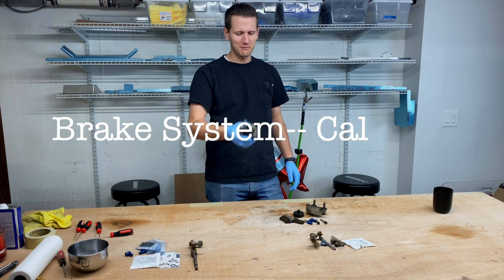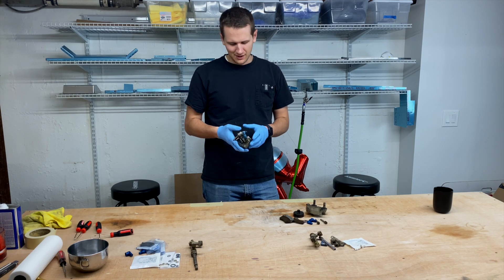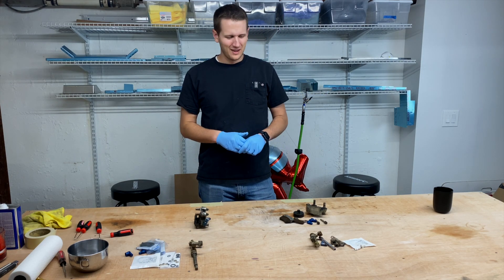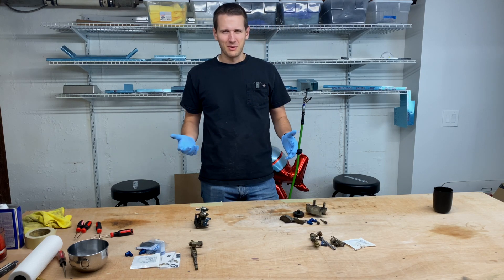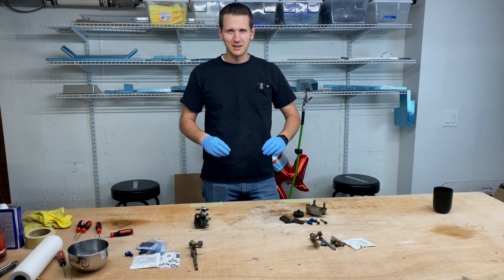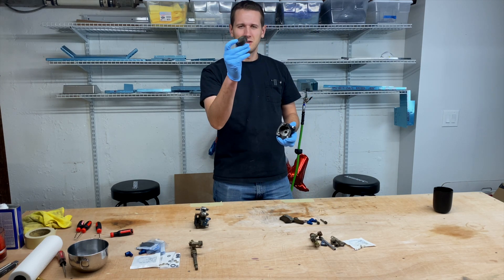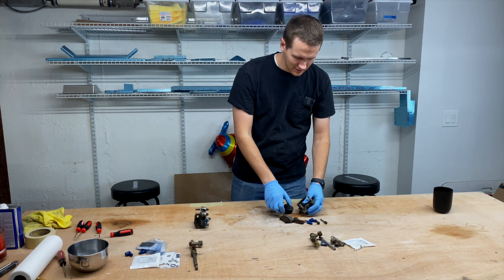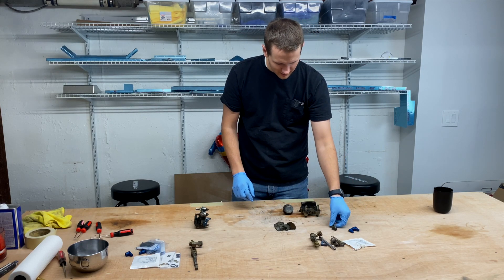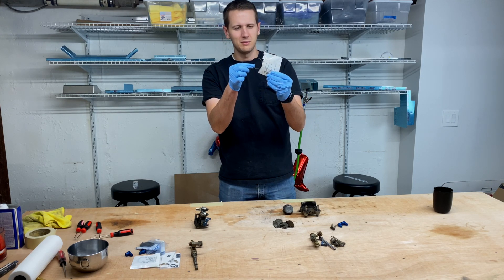Wheels are done and we have brakes. These are the calipers — Cleveland 30-75s. At one point we had a little leak in the left side out of the master cylinder, and we decided since everything's apart and we're doing new brake lines anyway — which were also leaking a little bit — why not just clean up everything, redo everything, and make it all new? Pretty simple: you have the caliper, a little puck, the o-ring — which goes in and out — the pads with new rivets, and some hardware. We have our o-ring right here and these should be fairly straightforward.